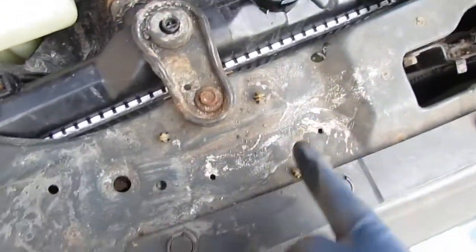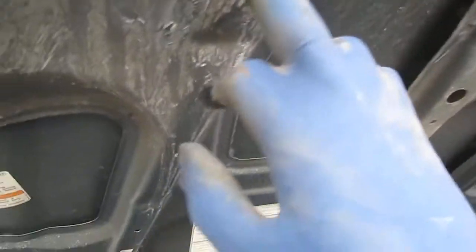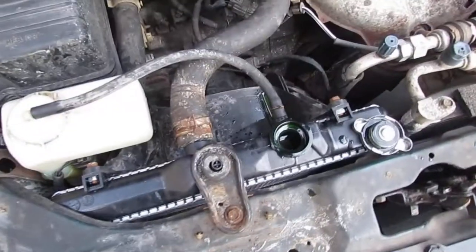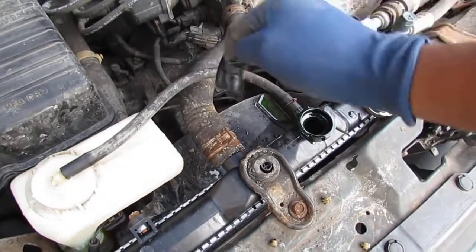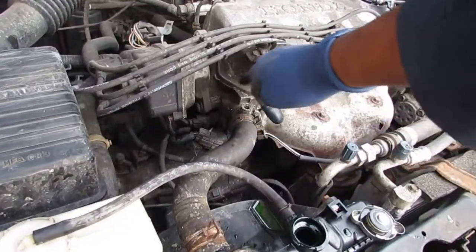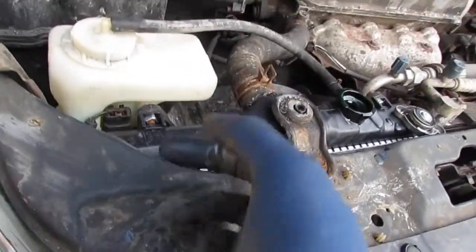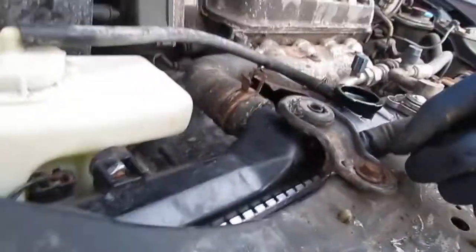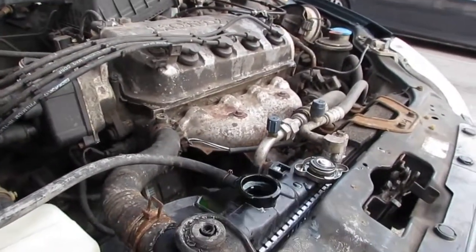Only to find out that I had this amazing amount of oil mixture. You kind of see it here, remnants of it. It's a couple days later, but it was all splattered right here. It was like oil and coolant mixture. What happened was this top hose here got so hot with oil coming out of the motor, because the warm coolant comes back in here to get cool from the top hose in the radiator. But right here in the radiator, this back part had a big gaping hole because it got so hot it just melted the plastic.